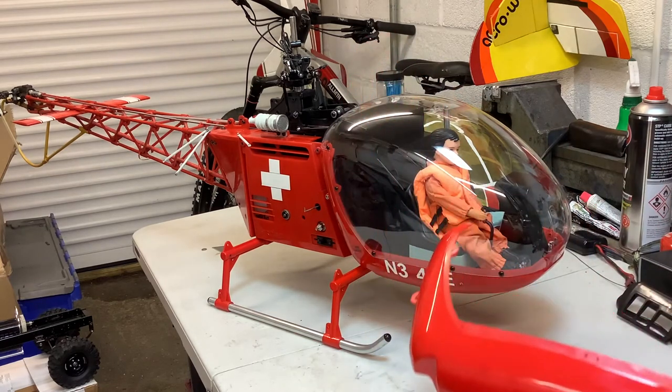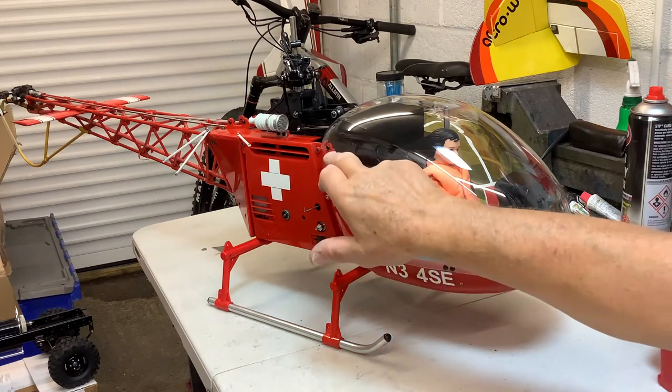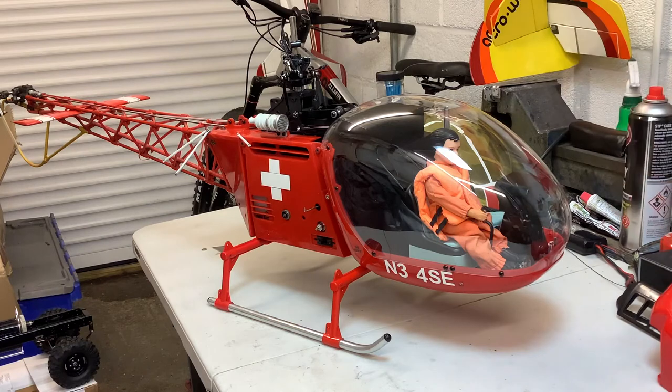If you could just buy the screen it'd be so nice. In the light you can see there's a line in the molding that comes around there, and quite a big flaw on the other side - it's all kind of pulled over one side. When you fit these, they've got little dimples where you should drill the holes, but whatever you do don't rely on them because they're in the wrong place and you can muck up your canopy.